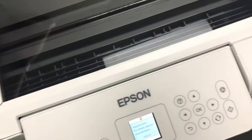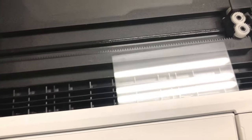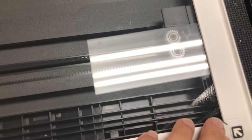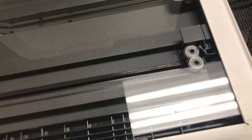This includes having a dirty cable so there's no power to the unit and it cannot move, or something physically obstructing the pathway of the scanner. The next thing is the lamp might be burned out — if you don't see a white light, the lamp has burned out, so it cannot scan that little patch and the sensor won't recognize the movement to the left.